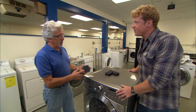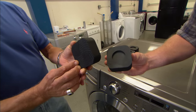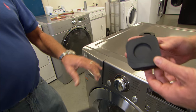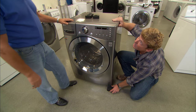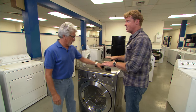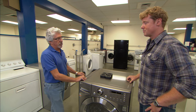To prevent the machine from walking, there's something called a vibration pad. The leg goes right inside the pad and it stays on the floor — it can't slide because it's got a nice hard rubber base, and everything is stable even during high-speed spin. At the very least, make sure the machine is nicely leveled using the leveling legs on the unit.